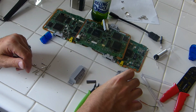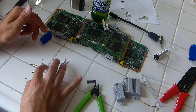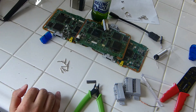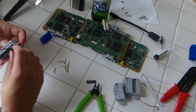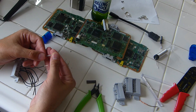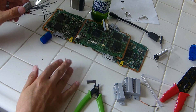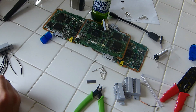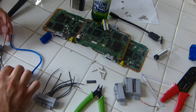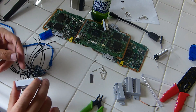Both of our pieces are looking good. As I said, you should have nine pins — do not lose them. For the next part, make sure your wires are ready. I've already done this on these controller ports, but as an example: take one end of your lead, solder it to one of those little pins, then press the pins right back in. They have little wings on the sides so they can only go in one way. Once soldered and slid in, put a little bit of hot glue on the back to keep them all in place.